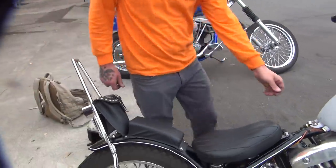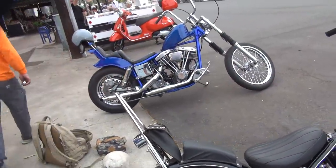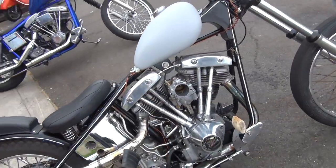So you got to play with it a little bit, and you got to get the accelerator pump played in a little bit. It's only under the biggest load. The thing is, you got to get the low speed jet to be the right one, so you go up or down with that until it works. It just struggles off a stop under load.